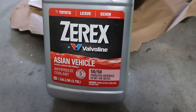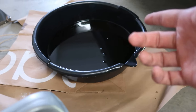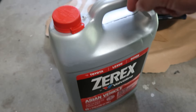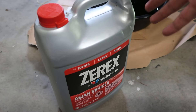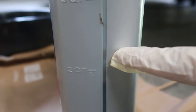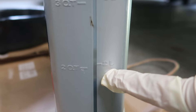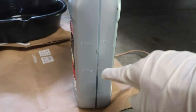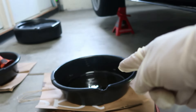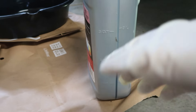I have an old coolant bottle — if you have an old oil bottle you guys can do that. I thought it'd be easier to drain it in there and then pour it in. You can obviously just catch all the fluid into just the bottle itself to prevent multiple steps. The fluid measured a little bit less than two quarts. So I'm going to fill the car with two quarts of transmission fluid and we'll see from there. I'd suggest doing this method so you have an accurate reading of how much fluid you're going to be adding instead of guessing.